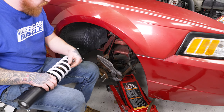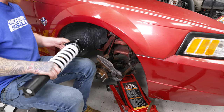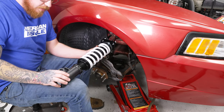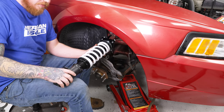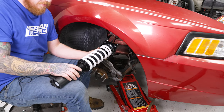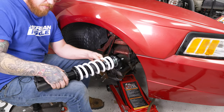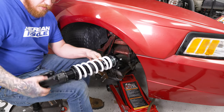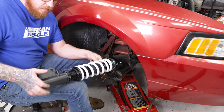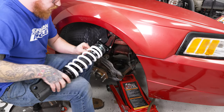Welcome back. Now that the front suspension is uninstalled, we can begin installing the new coilover kit. First, loosen the lower lock ring for the perch mount — that allows you to move it and get the spindle mounted where you want it, making things a lot easier. Relatively set your height adjustment beforehand. Back off the lock ring and spin it: right goes up lowering the vehicle, left goes down raising the vehicle. Get it roughly where you want it, then feed it through.